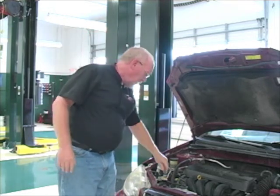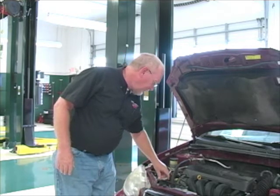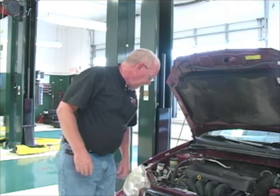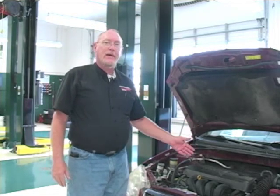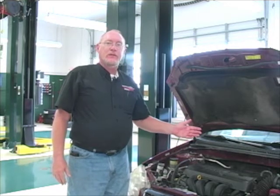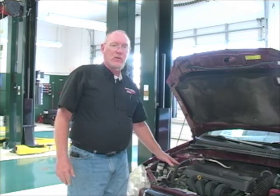Even so, I'm going to take a few minutes to just loosen the cap slowly to that first detent, make sure there's nothing going to just pop out on me before I remove it all the way. Now certainly if you have a system that's low on coolant, you want to determine why — coolant doesn't go away by itself. We have other resources for you at MotorAge.com that help you through basic cooling system tests. Today we're going to focus just on the coolant itself.